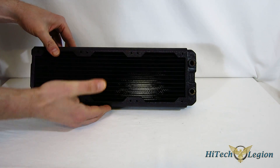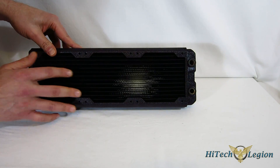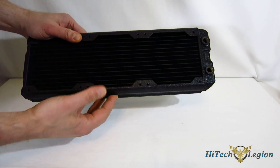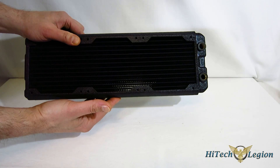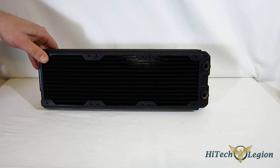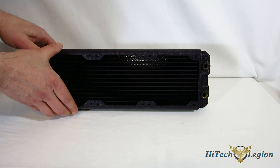It's a really fabulous looking radiator. Looking at the 25 micron copper fins — 16 FPI, so fairly dense but on the lower FPI scale. You can see through it pretty readily. It's going to perform well at lower RPM and scale well at higher RPM. You do have enough copper there for some serious cooling, but it's not dense enough where you're going to be choking at lower RPMs.